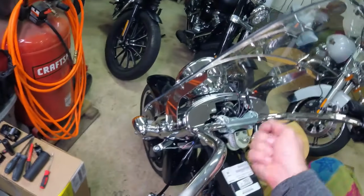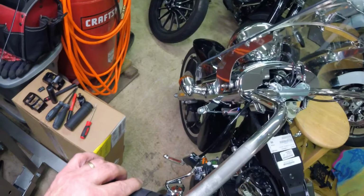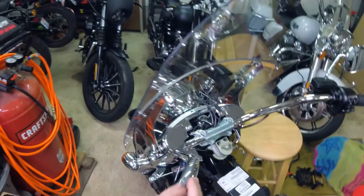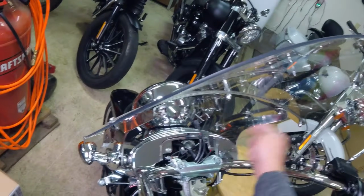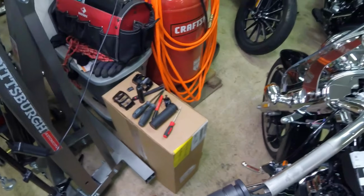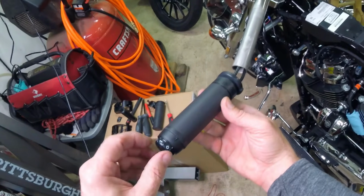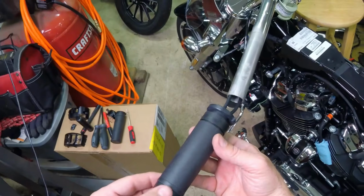All I'm gonna do from here is just, because I gotta even out these two wires. You can see one's definitely shorter than the other because I stagger them. You don't want to put the couplers together, it makes it harder to go down the bar. So the wires are out of length, so I'll sit here and feed them both and ease that thing in there, because ultimately this is gonna almost face me, the little trigger to tell you what position the switch is in. It's off now, obviously.